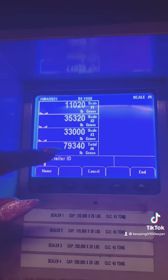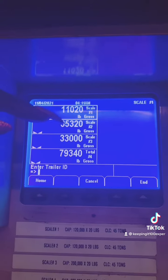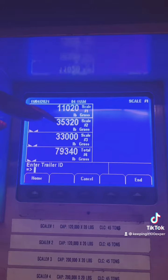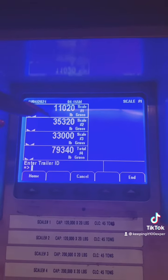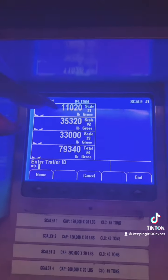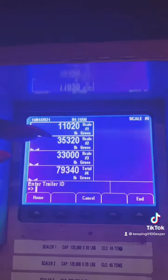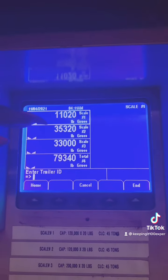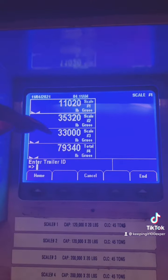I'm good with total weight. So if I take 1,300 off — each pair, which is two holes — each hole by itself is 250 pounds. A pair equals 500, so I need to back towards the problem, which is my drives. That means I need to back up about three slots, even though that'll put me like a couple hundred pounds over.